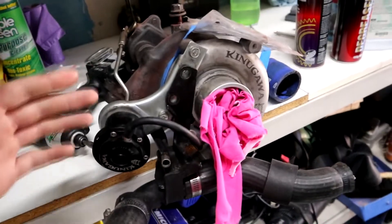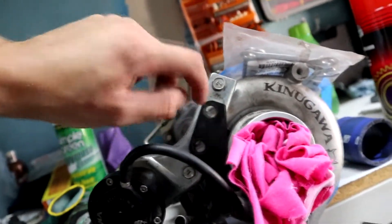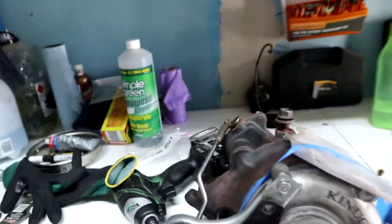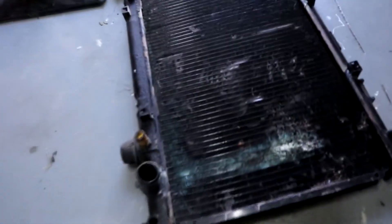I've been spending the last couple of days cleaning all the components for the car. On the oversized turbo, I've managed to fit everything so it's ready to drop into the car and attach to the exhaust manifold. All the coolant lines are now connected to the new turbo. The only issue I ran into is that two bolts are supposed to bolt a bracket into the wastegate bracket, but it doesn't quite line up. I'm just going to leave those out for now because I don't want to re-drill everything — it's not too big of a deal. Cleaning all these parts is driving me absolutely insane.